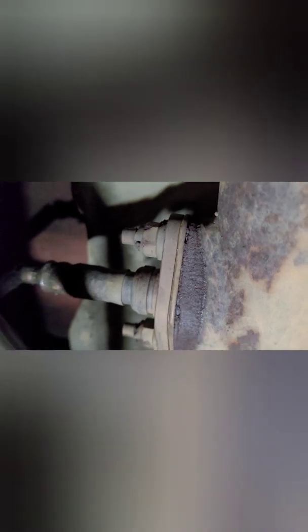All right, here we are under the truck. Now, this is not the typical O2 sensor we're used to with the screw-in bung. These are going to be 12 millimeter nuts, and we'll get those popped off and get the O2 unplugged from up inside the engine bay there and get it over on the bench and do some testing.